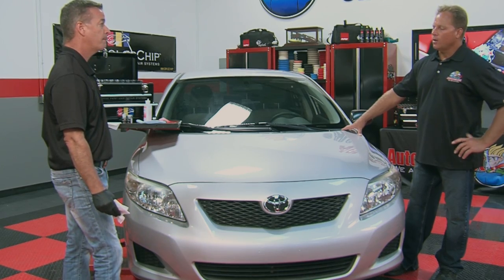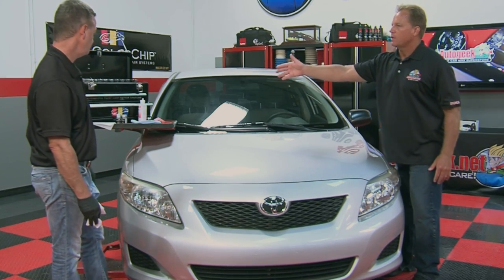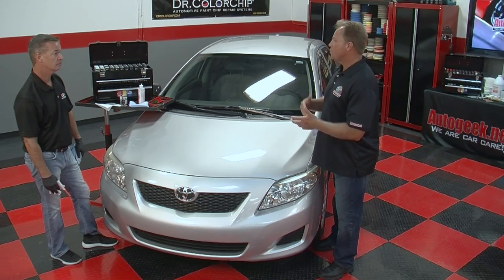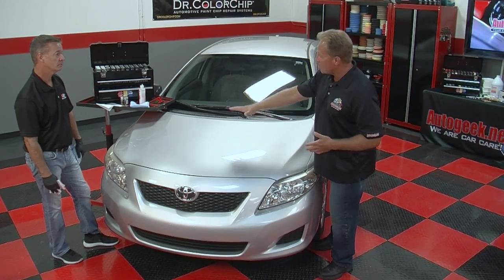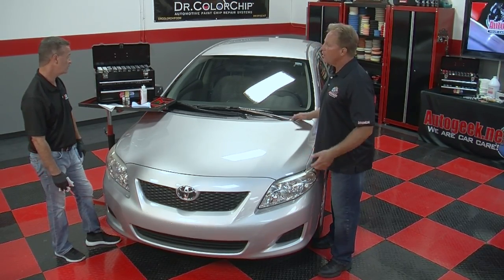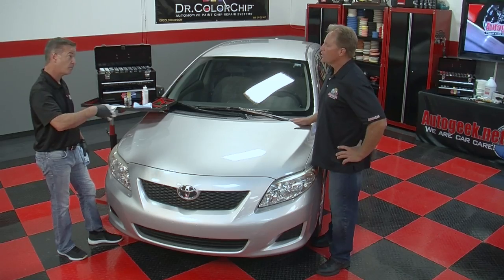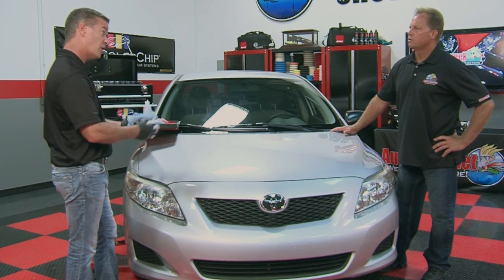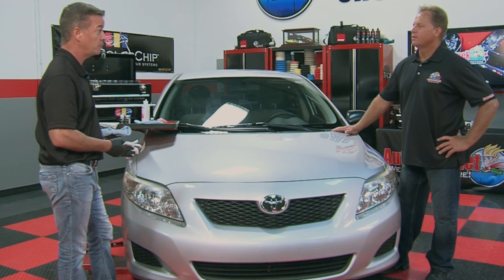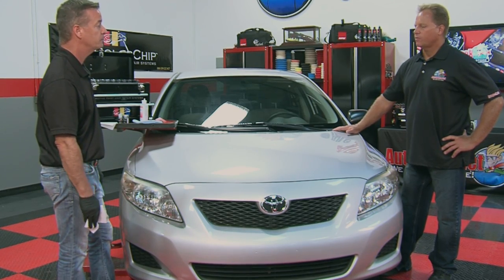Oh, yeah, absolutely. And also what I want to point out is when I look at the C-Lac blending solution, to me, I'm thinking this is a solvent that's going to dissolve paint, but it's really a lot more complicated than that, because when you get done wiping this down, it looks like you just put some wax on them, and it restores the shine, too. Correct. It serves a dual purpose. There is a sealant in there. As a part of the activating agent that softens the paint, the sealant will keep the paint that's in the chips and cover that and seal it and allow it to cure properly. So it's a dual purpose to that, and it also enhances the shine of the paint. Yeah, and then you don't have to carry around another product.